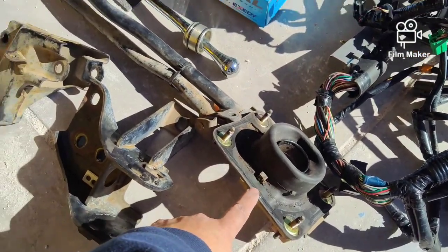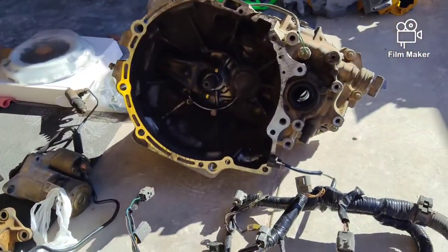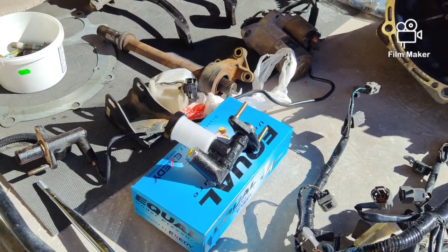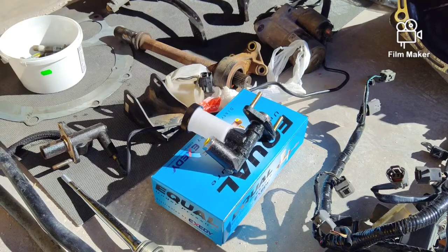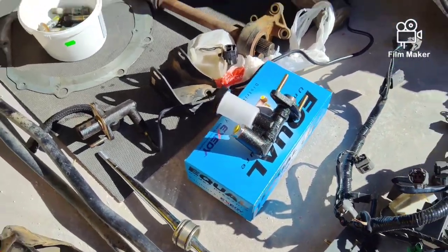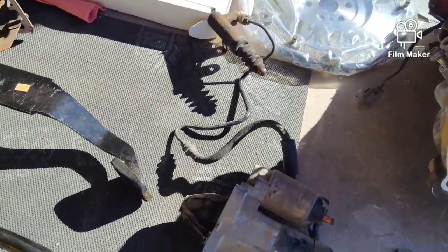You got the shift plate and the shift linkage. We've got the brackets for the trans that go in there. 5-speed. I have a clutch master from a Mazda B2500, and I went that route because I didn't want to tie into the brake line. I read somewhere that the Mazda setup, Protege setup, goes into the brake line, and I wasn't comfortable with that. So you guys can see here's the factory Mazda Protege clutch master, and over there's the slave.